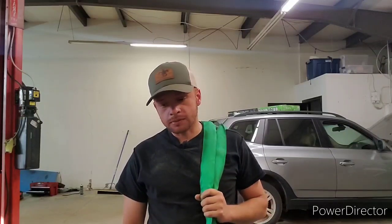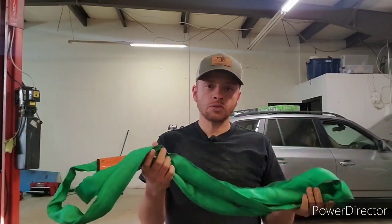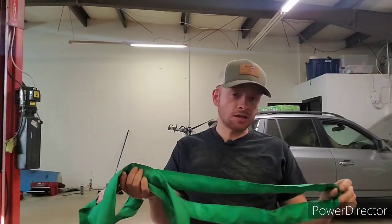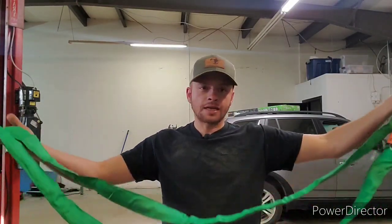Equipment that I use, commonly use — and that piece of equipment is going to be a round sling, also known as a continuous loop. This is synthetic. I know many of you have seen these. This is my go-to for a lot of things, especially recovery work. I like the simplicity behind it, how light it is compared to a chain. It's easy on the hands, easy on the back. This is a six-foot sling here, probably about 25 bucks.